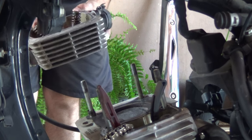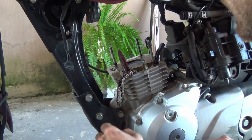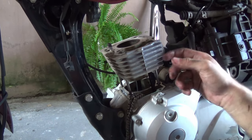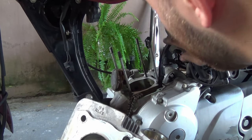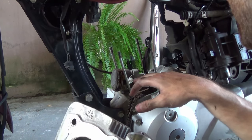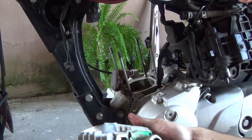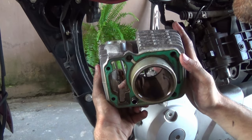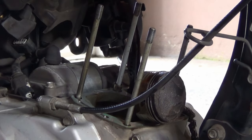This is the actual tensioner guide — the part the tensioner pushes on to tension the chain. What happened last time is that this little piece broke into a bazillion pieces because it's like a bakelite or plastic and it had dried out — and that wasn't fun. This is the gasket I was talking about: if I want to remove this gasket from the bottom it would take me four or five hours. That's the part I hate most about engine building — it's where things can go horribly wrong.